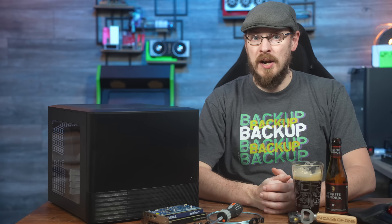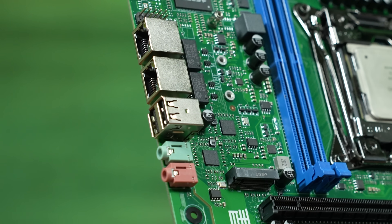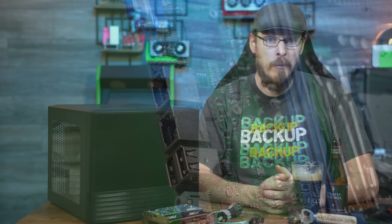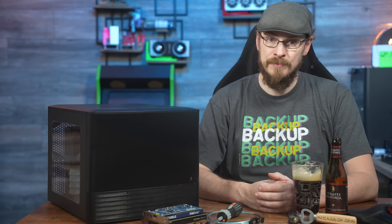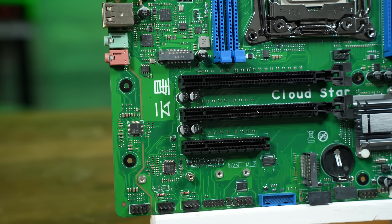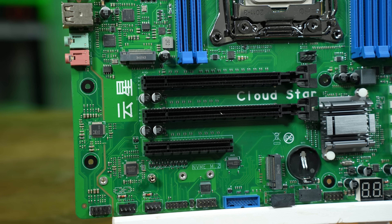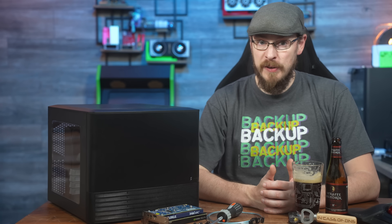What about networking? The CloudStar board is above average here as well, with a pair of Intel i226 2.5-gigabit network ports on the rear. Having 2.5-gigabit networking built in means you don't need to install a PCIe card just to get faster-than-gig networking. Speaking of all those saved PCI Express slots, we've got a pair of Gen 3x4 M.2 NVMe slots for high-speed storage, two full PCIe 3.0 x16 slots and a single PCIe 3.0 x8, all of which support full bifurcation or PCI Express pass-through for virtual machines.